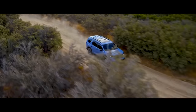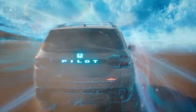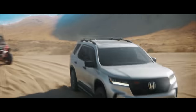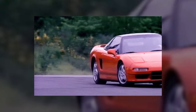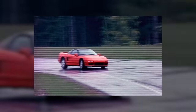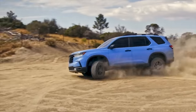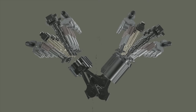It's codenamed J35Y8, and it's the new V6 for the 2023 Honda Pilot, except that this time Honda has dropped its iconic variable valve timing VTEC and added an additional camshaft for each bank. This is the first naturally aspirated dual overhead cam V6 in any Honda or Acura since the first generation NSX. Today we're looking at the new V6 engine, why Honda dropped VTEC, and how this engine will be significantly cheaper.